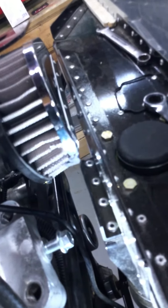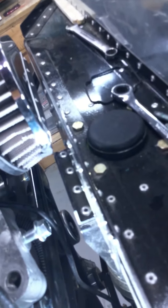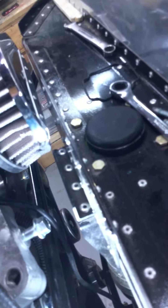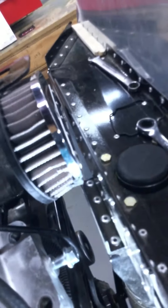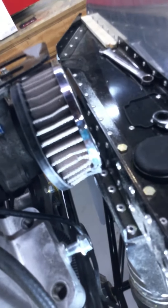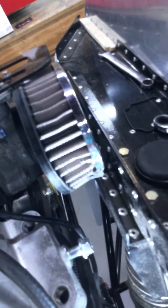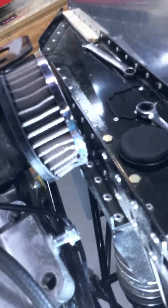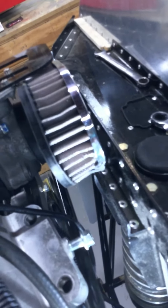It's not permanently put in place, but there's the fit on that side. We've got much better clearance around the front of it — you can see there's almost a centimeter there — and it's also clear of the L bracket around the shock mount for the front nose gear. I think it's going to be adequate clearance. I don't think I cut down the intake more than 20%, so that should be adequate, and I should have sufficient surface area for air to pass through.